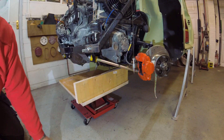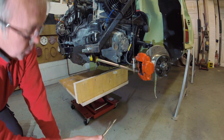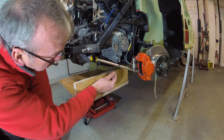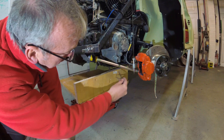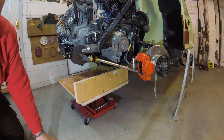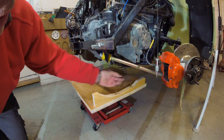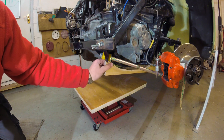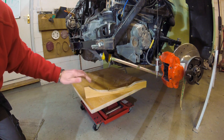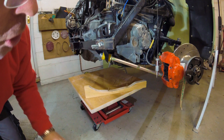If I go right underneath the car you won't be able to see exactly what I'm doing. What I've used is just a standard compass, and you can use the compass to trace the shape of your subframe — mine's a sort of step design. Just mark the wood and cut out a piece for the passenger side, and a similar arrangement for the driver's side. I'll show you what you should end up with — I've taken the template and cut it out with a jigsaw. The plan is to fit a piece of rubber on top to cushion and stop chipping the paint off the subframe.